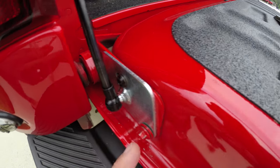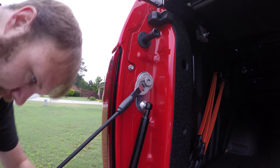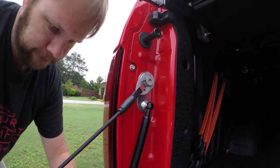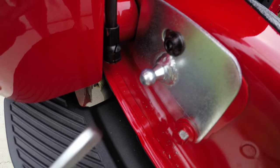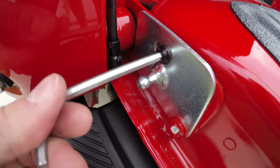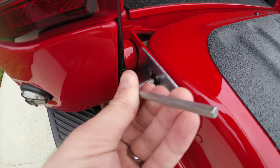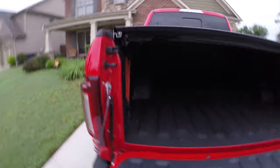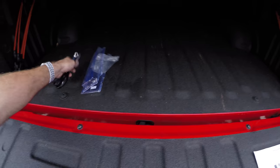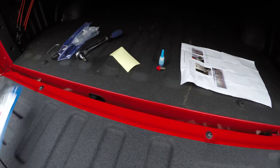Got this piece nice and snug, reconnected the way it was. Now at the bottom I'll re-snug this bolt and retighten the factory bolt. Quick pro tip: make sure you tighten down the top bolt with the allen wrench before you clip on the bottom, because once you clip on the bottom you won't be able to get to it — quick lesson learned. The only other thing left is to install that little guard to make sure none of the edges rub against each other, but first let's test it out.